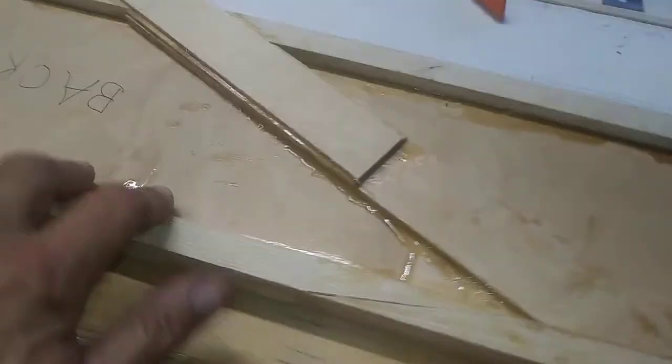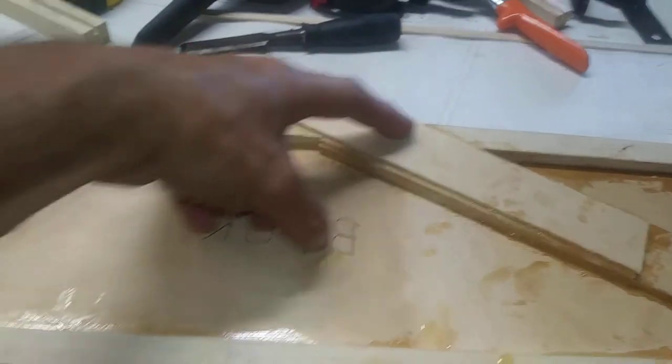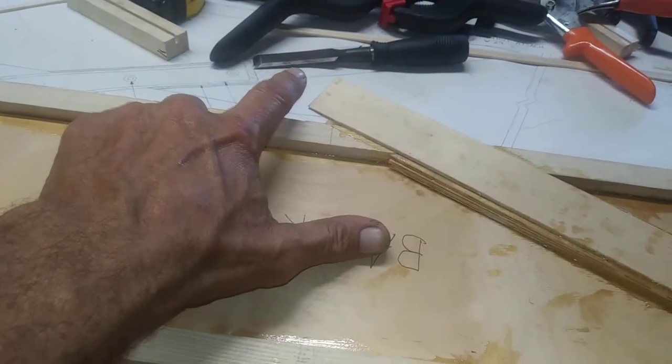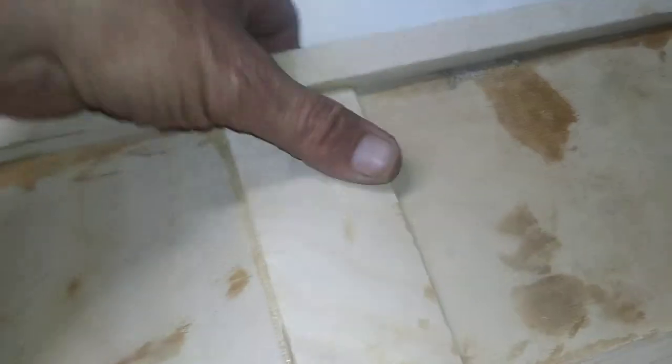I have a lot of cleanup to do, but right here are your strut attach points. This here will be whacked off right there. Your aluminum pieces will go out here to attach the strut. Another cap where the webbing was butted up, and then building up — there's a strut attach point, a jury strut, and then building up for your carry-through.